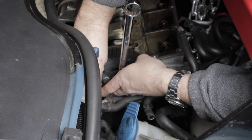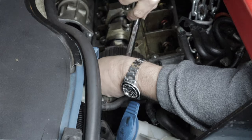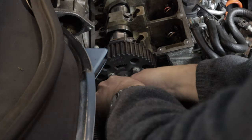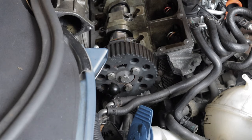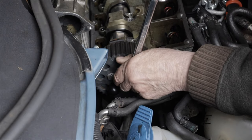Now to check that the camshaft and crankshaft are in place. Using a Volkswagen timing kit — you can buy from a lot of places like eBay. As you can see through the hole it's not lined up just at that second; I'll show you it lined up in a minute. There's a hole on the engine block just at the bottom — you slide the pin through the camshaft into that hole and that locks it in position. Push the pin in fully. As you can see, this is when it's lined up. You push the pin in there and that lines up everything. I'm just showing you with a spanner that it's locked in place so it can't move.